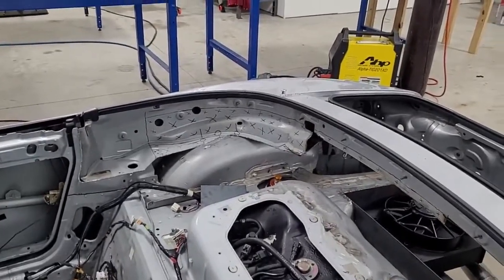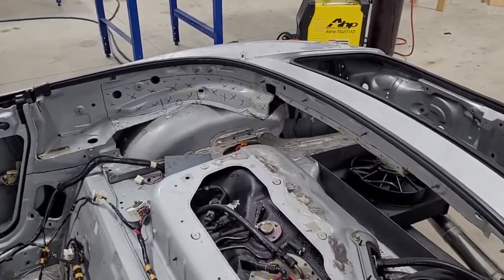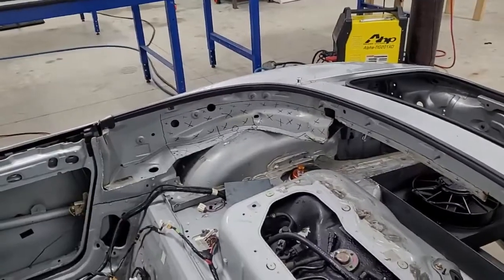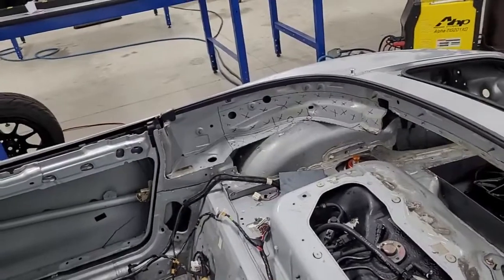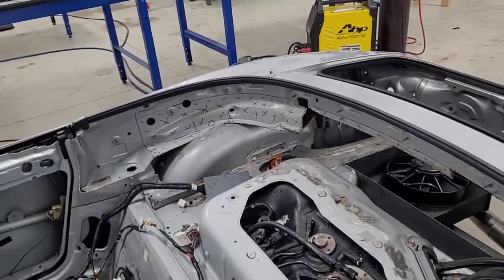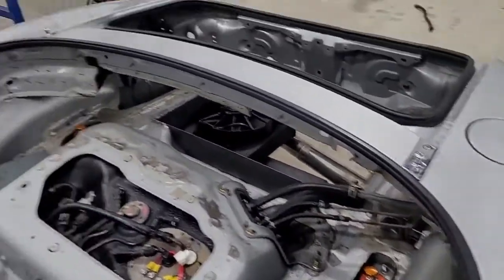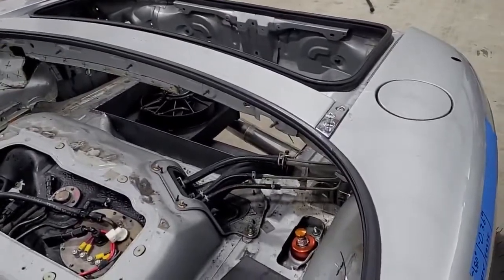What I think they did — the reason they have all these different layers of steel and the way they put them in the car back here — I think this is for crash worthiness. That's my guess, because there's multiple layers of thin metal that's pretty flexible and it's just kind of spot welded together. I got a feeling that if you get in a big wreck, it can actually absorb energy. That's what I think that's for, because it's really not an efficient use of torsional stiffness. This beam that goes across the back here — there was some strength in that tying both ends of the car together.